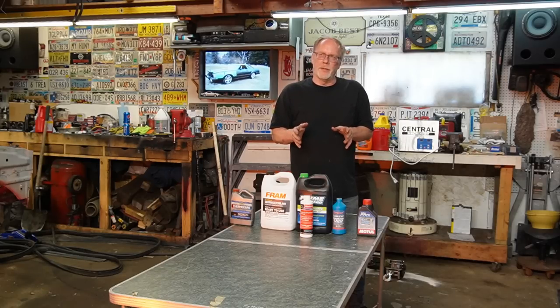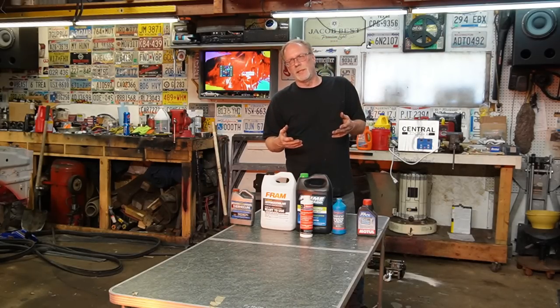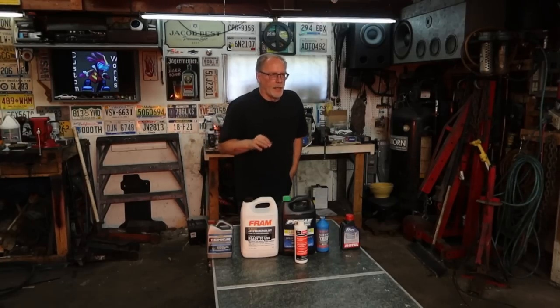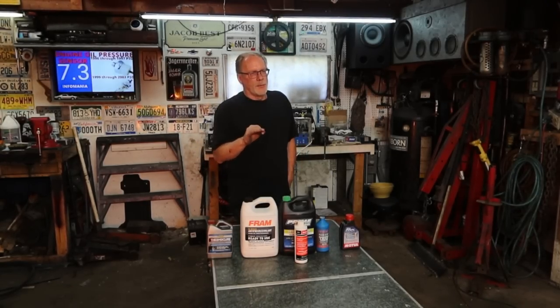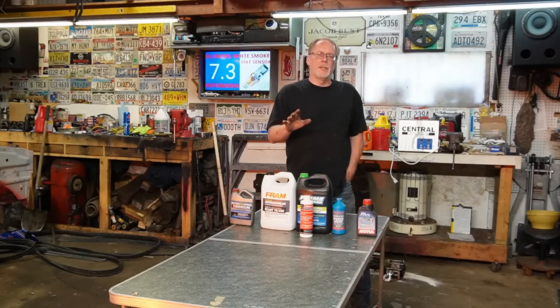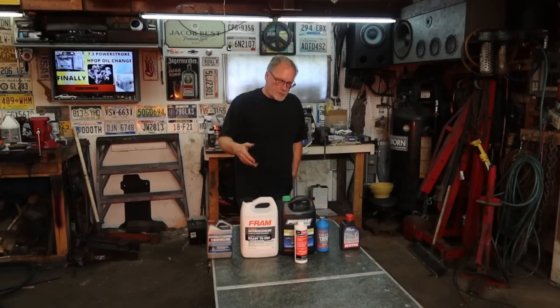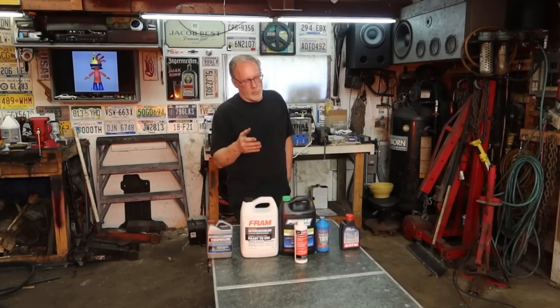So anything that is post of that February 1999 is when we move into 99.5. Now, everything that is 99.5 on up through 2003 has been made ELC compatible, and that is the gold. To be more specific, gold hybrid HOAT fluid.